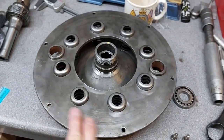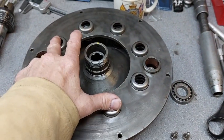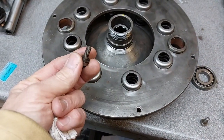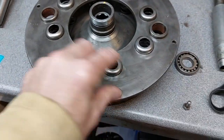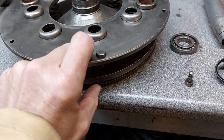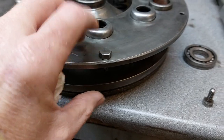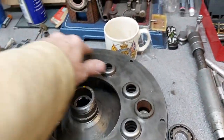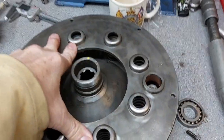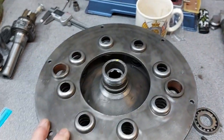And the second problem I need a mechanical solution for is compressing the clutch assembly, because these are the bolts used to fix it down, and when you pop the clutch assembly into the flywheel, the gap between there and the flywheel with the springs at full extension is too long to be able to get these to bite. And doing it single-handedly, you can't press this in by yourself.